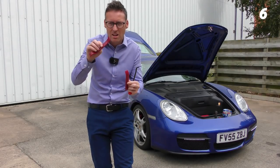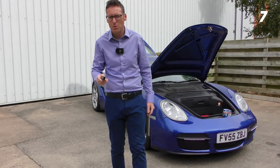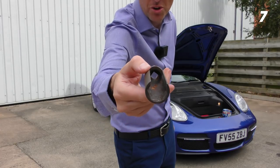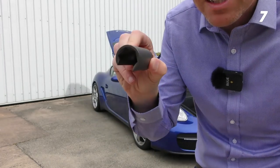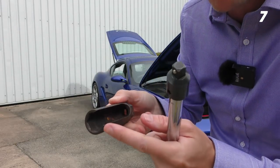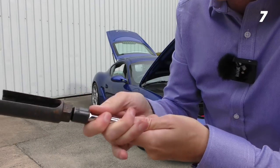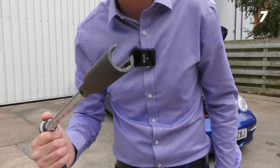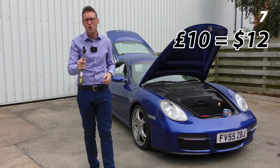The clip kit also comes with little tools to get the old rivets out — really handy. Next up is a tool which will allow you to remove O2 sensors from your car. It's a very basic tool — it almost looks like a socket with a quarter of it removed. This end is a 22mm socket that goes over the O2 sensor, but since the O2 sensor has a cable coming out of it, you slot the cable through the gap. You put that over it, connect your socket kit, and then unscrew the O2 sensor. It's a great little tool, very cheap — about £10. Recommended if you're working on your own car.